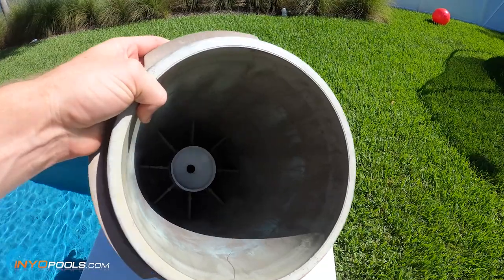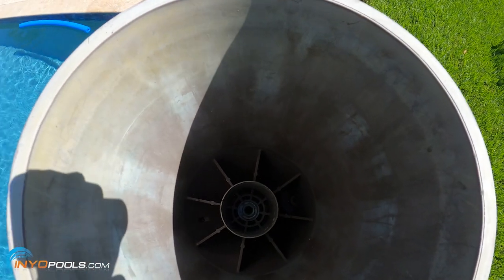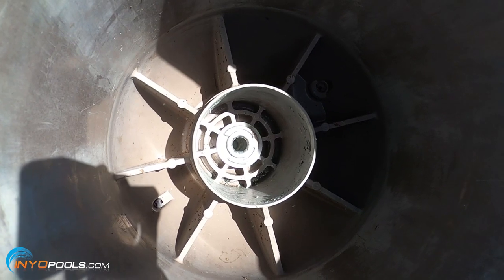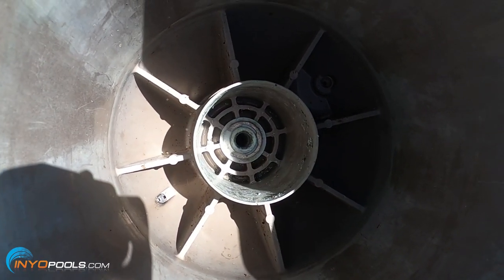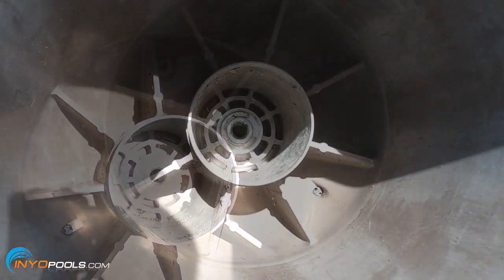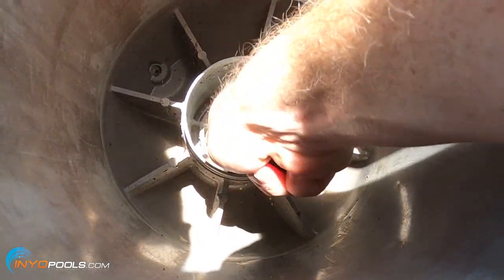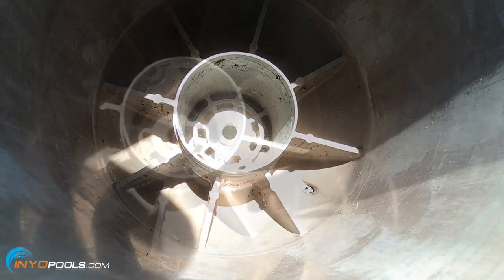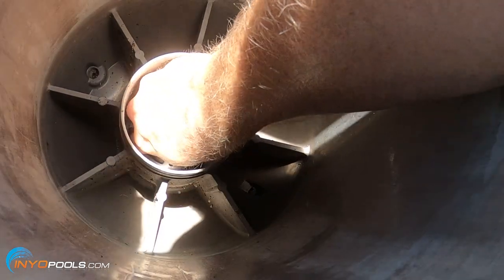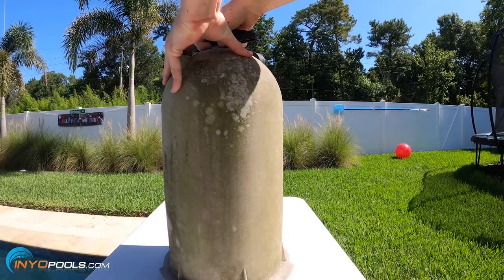Look at the inside of the lid. The first thing you'll want to do is remove the cone. You'll notice at the bottom there is a metal clip that secures the knob to the lid. Take a flathead screwdriver and pop that metal ring off. Once removed, you can go ahead and take out the metal ring — we've got a new one in the kit, so you don't need to keep that. Same thing with the washer — you can remove that. Then you can just pop the old knob off.